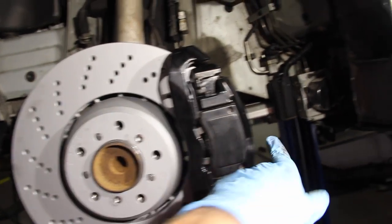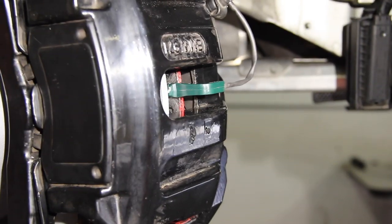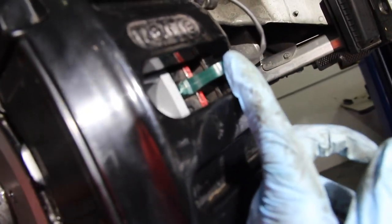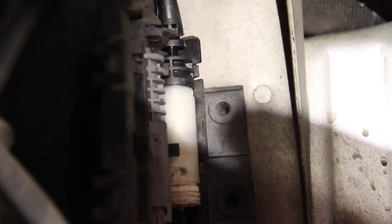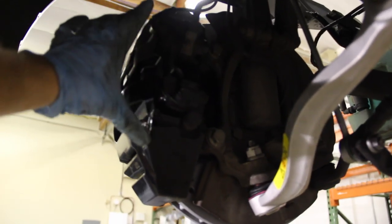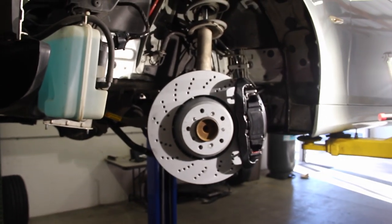The only thing I have left to do is replace the brake pad wear sensor, which is just the opposite of how we removed it. Never seen a green one before, but apparently the front left brake pad wear sensor on the E60 M5 is now green - that's a genuine BMW part. It snaps into the little slot in the pad, comes over here, goes around the bleeder screw, this part goes in the clamp, and then there's another little groove for weatherproofing. Push the connectors together until they snap, then close the door. The torque for the guide pins that hold the caliper onto the caliper carrier is 22 foot-pounds. And we're done on this corner. The passenger side is one-for-one identical to the driver's side.